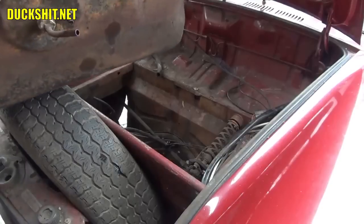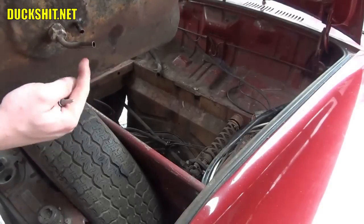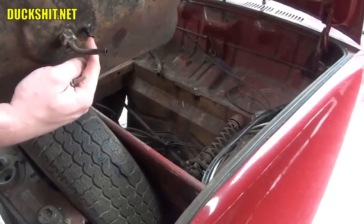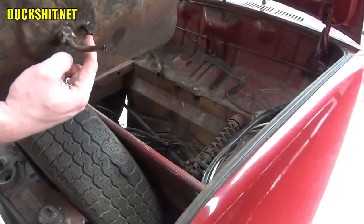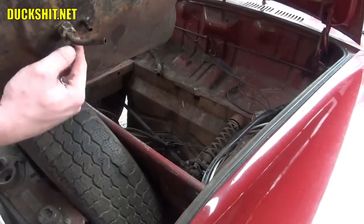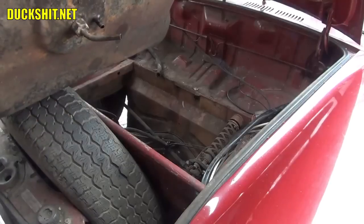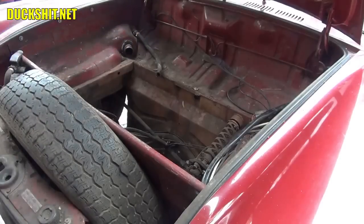On a Fastback, there's the second outlet. And this is a carbureted car, but I use that anyway as a return line. It escapes the residual pressure from the fuel line when I turn the key off, so there's no pressure sitting in the carburetors. It's weird that they do this, but they boil over, and they continue to have fuel feeding into the carburetor bowls from whatever residual pressure is left in that line. So I do use that line. Normally you wouldn't see that on a Beetle.